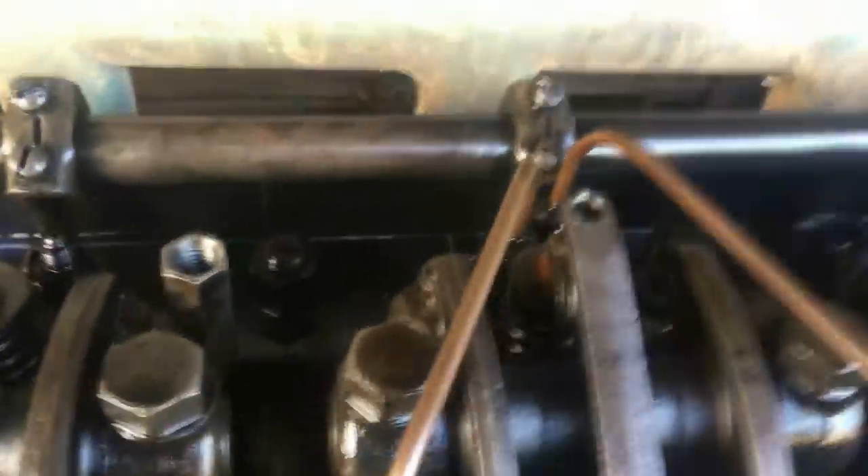So I'm working on a 671 here and got quite a few interesting little finds to show you. One thing is they've used this rack for a non-offset injector. See how at the very bottom there's a foot that goes over and into the injector — so they've moved them over. I've never seen that before, which isn't really a problem until you get to where to shut the rack off. You just gotta make sure they're in a good enough position where it's nearly touching right there. So that's one thing, not a big concern, but just something I've not seen before.